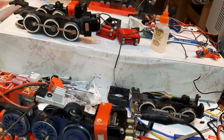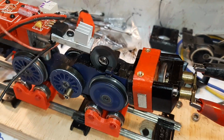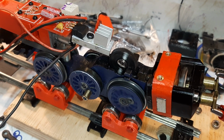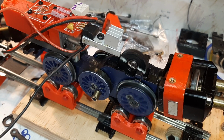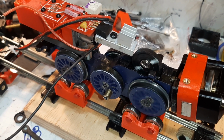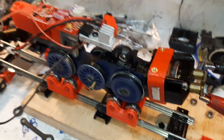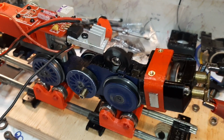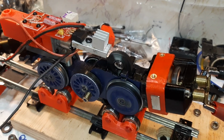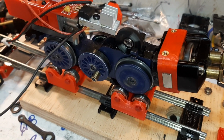It's like the Mazda, you know, humming, just a hummer. Very smooth. And there's a growl at the start at low speed, like right in there. I'm going to attribute that to loose axle bearings. And what I decided to do was let it go with the axle bearings on the other side of 50% probably. If you were really restoring the engine, you'd probably change them.